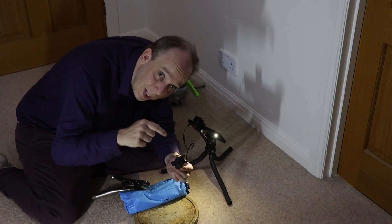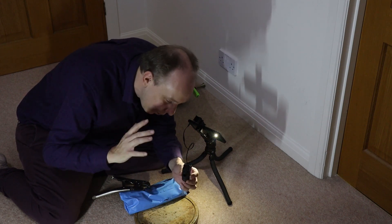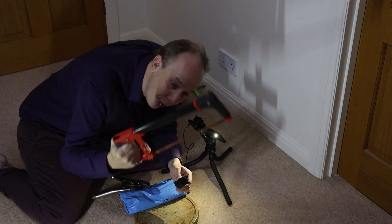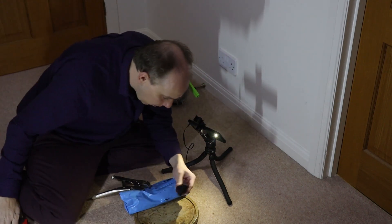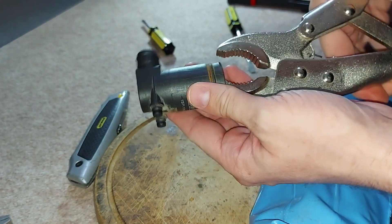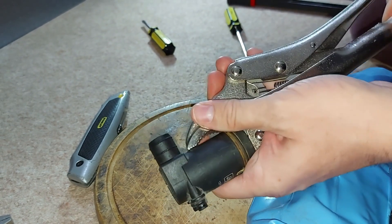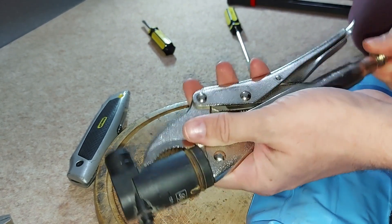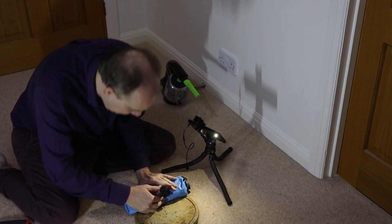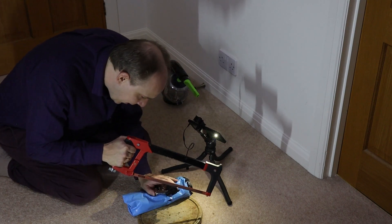Now I'd also like to have a look at the little impeller, which is stuck down there at the bottom of the motor. There's no easy way to get to that, so I'm going to have to force my way in with this hacksaw. I'm not keen to cut my hand off, so I'm going to grip the pump — or what's left of it — with these mole grips. And then I'm going to balance that on my spanners.